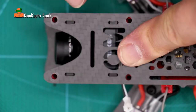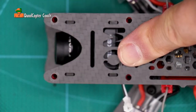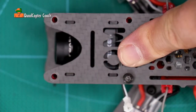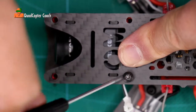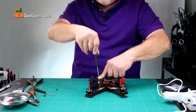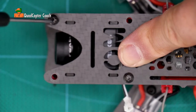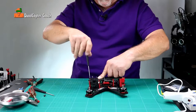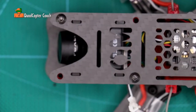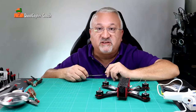Now that the tabs of the camera mount are in place in their slots, we want to button this down by taking a 6mm bolt and putting it closest to the QM. The reason for that is to apply pressure closest to those tabs so the camera mount stays put. Once I get two bolts in there I'm in good shape — I won't go all the way tight until I get them all in.